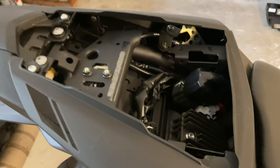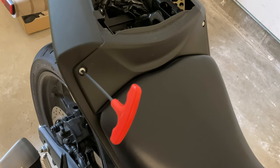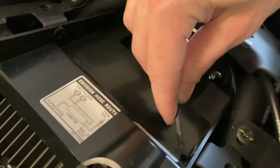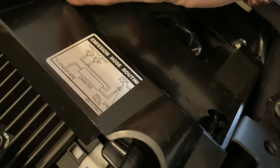You're going to want to start by removing your rear seat. Next, using a three millimeter hex tool, you're going to want to take this trim panel off. On the inside of this tray you have to pop these things — you just press something into them like that — and then they come out like that, and then you just lift the tray out.